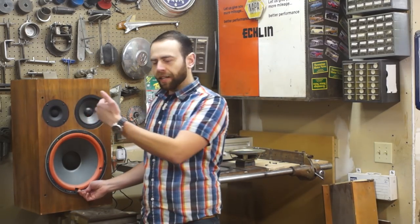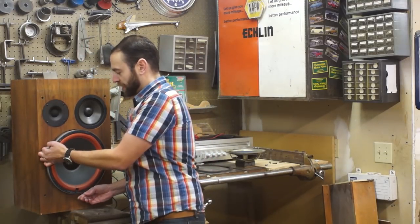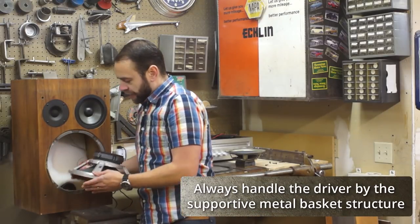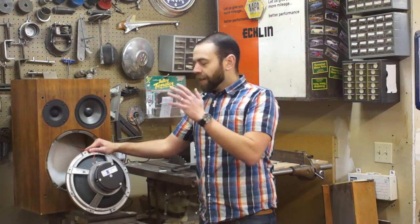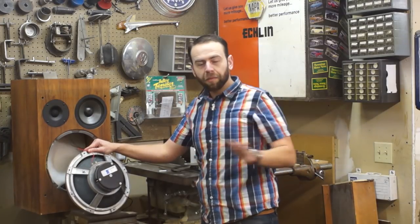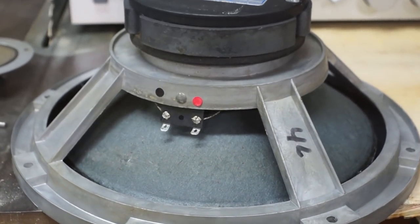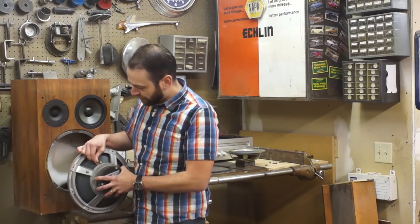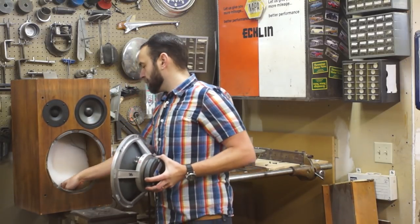It might be easy to put your hand on the front and tip the whole speaker forward, or in this case it kind of wants to fall out, so I'm just carefully removing it. Now the next bit to be concerned with are the speaker wires. If you're lucky, like on this model, it's nicely labeled — there's a red and a black wire, the positive and the negative. This one has a little red dot indicating which wire goes to which terminal, so just pull these off. You can easily remember how to put them back together.